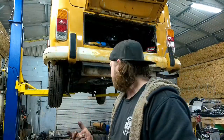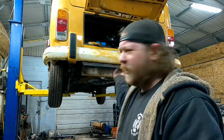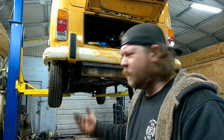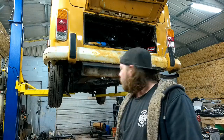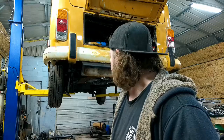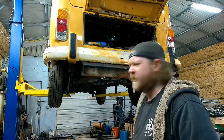Volkswagens, yeah, obviously, they leak. Yes, you can make them not leak. This is an older engine. I'd be surprised if it was dry, but the leaks to me are the oil cooler, which on the pancakes is in the front of the engine or back, whatever, this side of the engine, and then the rear main. So I'd advise him to get those done if he wants them, if it's not annoying him as far as leaking, because it does definitely mark its territory. Other than that, it seems fine. But yeah, rear main and oil cooler seem like the majority of the leaks.